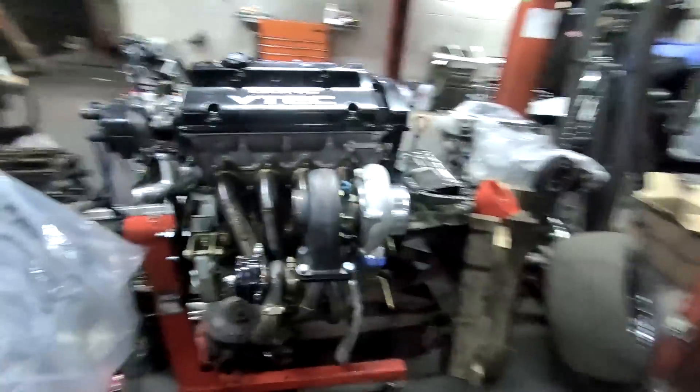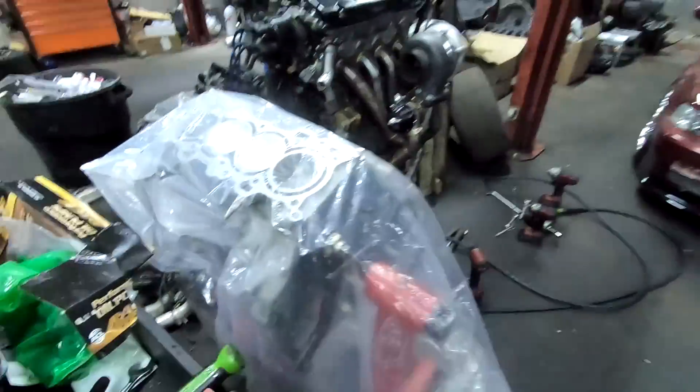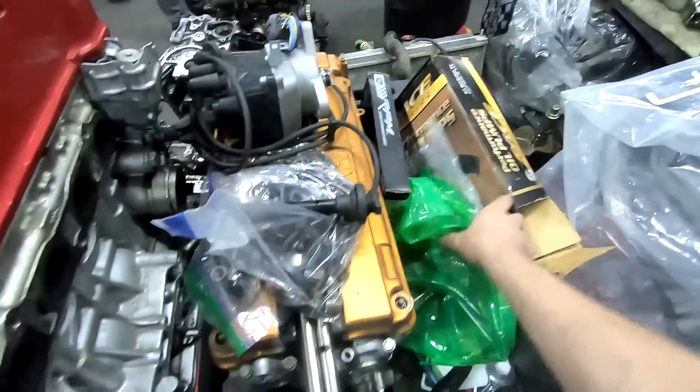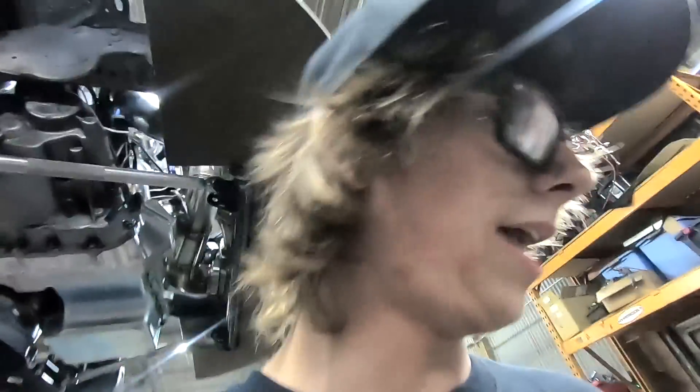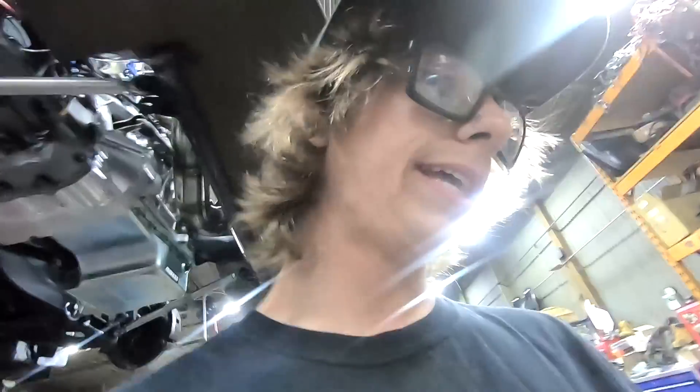This thing's ready to go - we're just knocking them out. I need to get the K-series off the stand, Mario's off the stand probably after we fix that bracket, but this B-series is coming along really, really well. Everything's coming along great in the short block, everything's torqued. I didn't put the head on yet because I'm gonna ask Jamie and figure out if we got studs - in his box over here he's just got head bolts, but this thing's fully built: rods, pistons, everything. I'm gonna ask and make sure - probably put some studs in there. We'll talk to Jamie, figure out head studs or head bolts, get that torqued down, and that'll be all set.